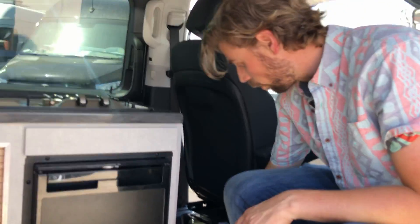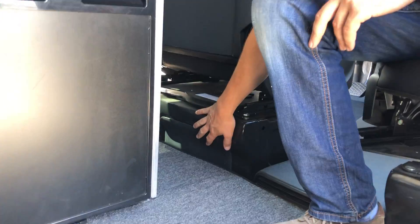All of the items in the back of the van are individually fused, so if there's an issue with only one thing — a 12-volt socket's not working, a refrigerator's not working, or a water pump's not working — but the other items still work, that tells me that a fuse is blown. The fuses on this van are located on the back side of the driver's seat box.